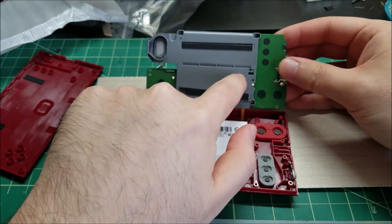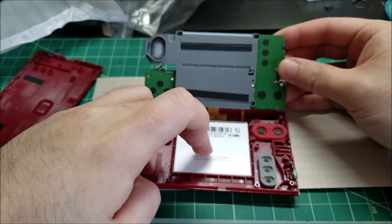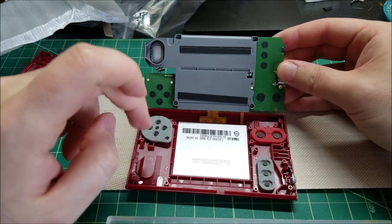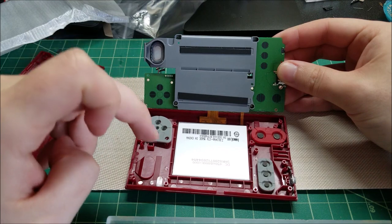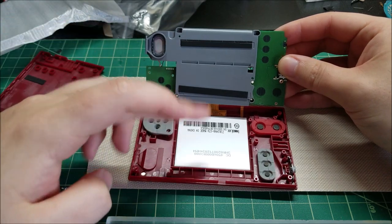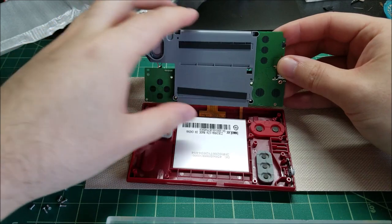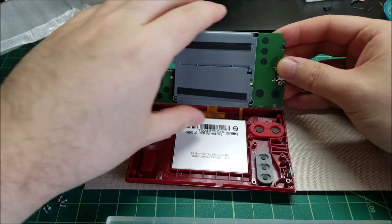And wow, for some reason, I did not expect this mid frame to extend all the way down. I guess the LCD is so thin, and it looks like an Innolux. It's a ZJ024NA-17A, made in China. It's probably something similar to what was in old gen phones. It's just an off-the-shelf screen. You can see on the front of the speaker there's a little Mylar film.